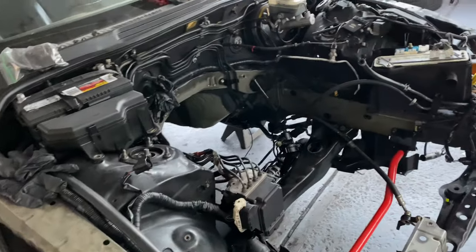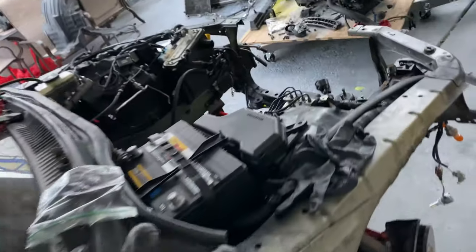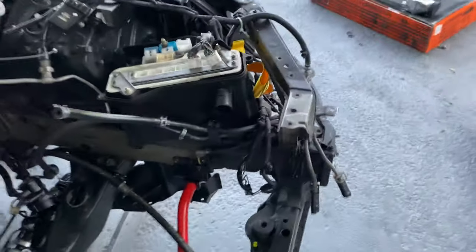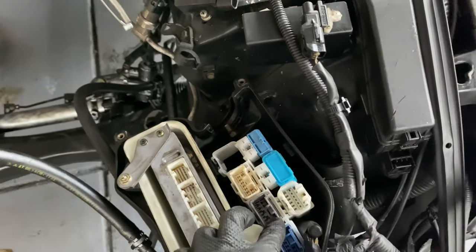The biggest thing after that is wiring. Multiple places sell adapter harnesses or complete engine harnesses to adapt to the ECU. But Chad G. Garage actually has a really good video showing you literally each wire and what you need to splice into the ECU — he shows you exactly what wire on the body harness to splice to the IS-300 body harness. If you guys didn't know, the 1JZ body harness plugs directly into the IS-300 body harness — the swap is meant to be.